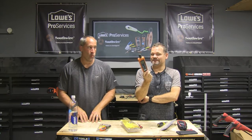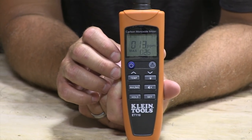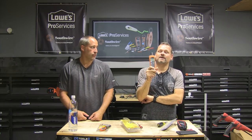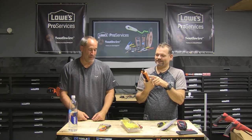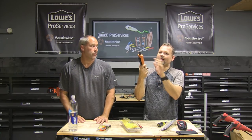Carbon monoxide detector — this thing's pretty cool. We showed you at the beginning of the video: we started it at the vent in the garage for 30 seconds — not recommended — but right away Eric put it by the exhaust and it took off, said get the hell out. We took it outside and it slowly came down. Right now we're at 18 PPM, getting a yellow flash. The max we've had in here is 25 PPM. It will flash red when you're in a danger zone.